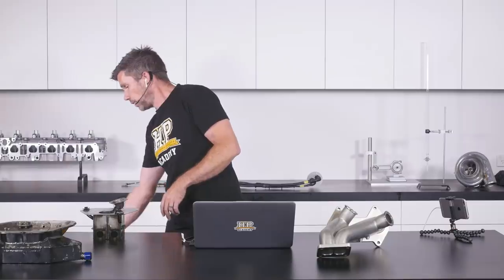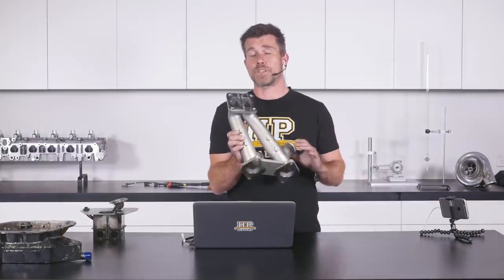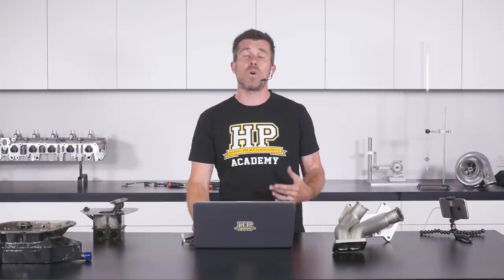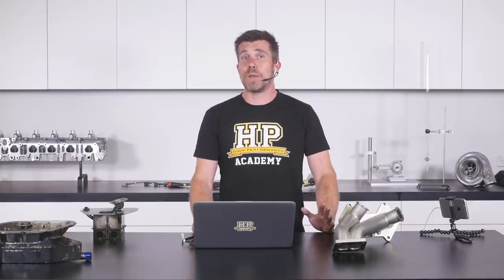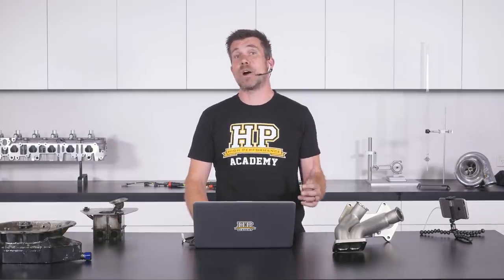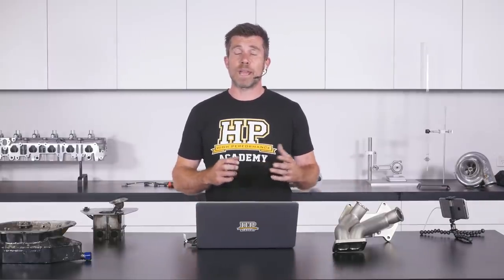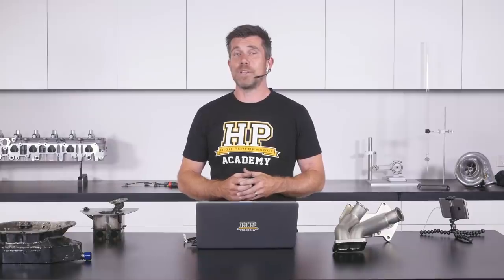The other port on that exhaust manifold is going to be for exhaust manifold back pressure. So we've got four ports — two of them for EGT, two of them for exhaust manifold back pressure — and we're going to be using those as inputs to our ECU. There are a variety of advantages to measuring exhaust back pressure. It's a really good guide for how well your turbocharger is mapped to the engine, and we can actually integrate the exhaust manifold back pressure signal as part of our main fuel calculation as well. The advantage is it can essentially automatically compensate for changes in barometric pressure or altitude, so your tune should theoretically stay more consistent. The problem is you need to mount the sensor in a way that it will measure that pressure without getting damaged — fitting a pressure sensor directly to the exhaust manifold is not going to work, it's going to be exposed to 900 plus degrees centigrade.